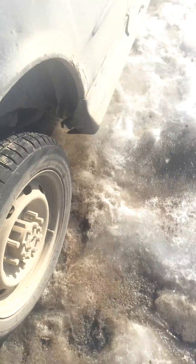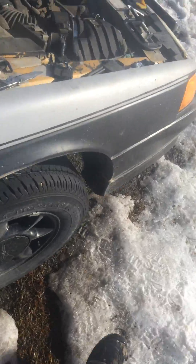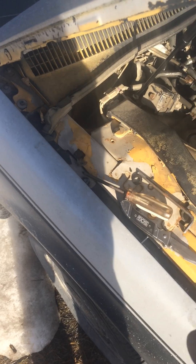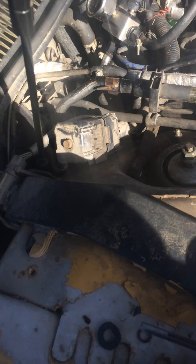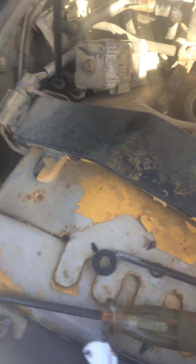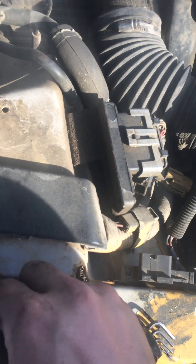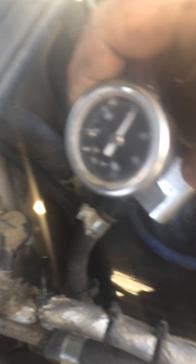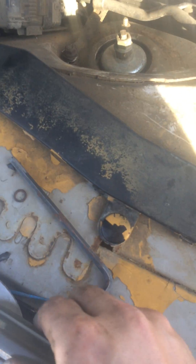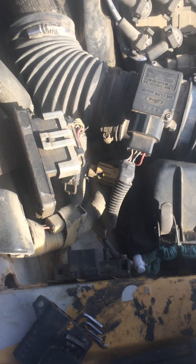There's a tiny little screen filter in it right there where it picks up, and a bunch of fittings to get them to run in parallel. With those marine pumps pushing 400 gallons an hour into that injector pump, the fuel pressure regulator over here is rock steady, because the injector pump has finer gears in it and smooths everything out.